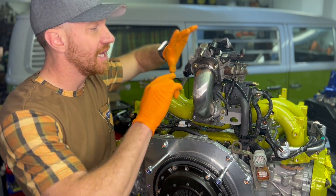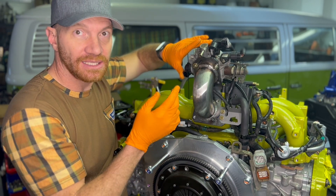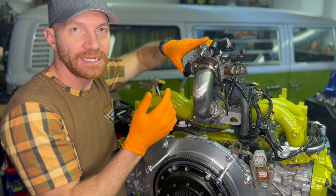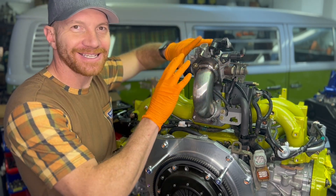Just to put your mind at ease if you're doing this: there's no real magic to it — you cut it, you splice it. If any of these wires were shielded wires, you'd need to replace them with like wire including the shielding and extend as such. But these aren't shielded, so you're fine to extend them.